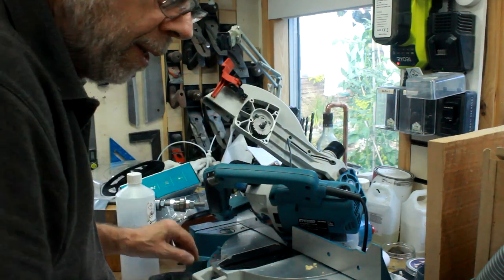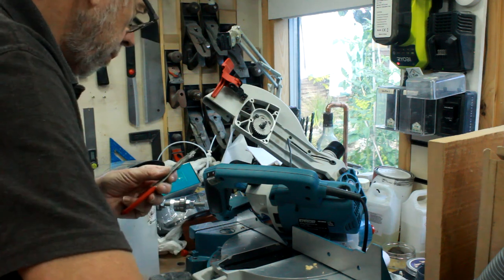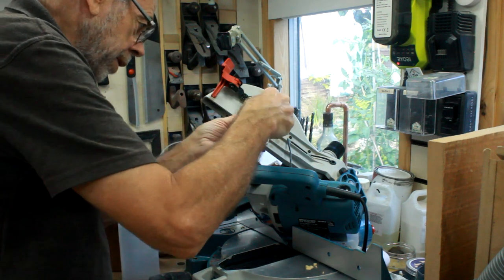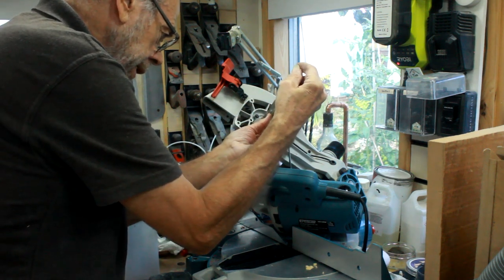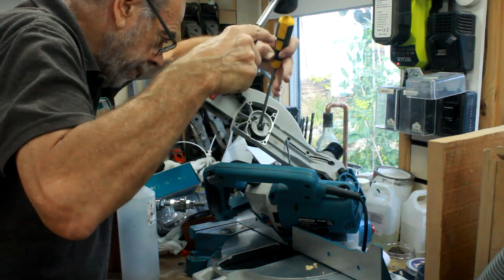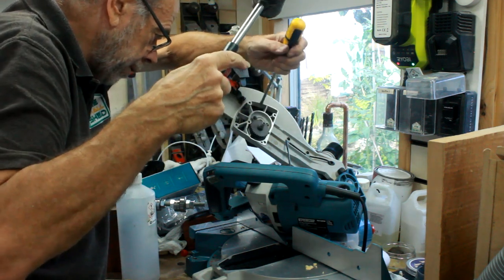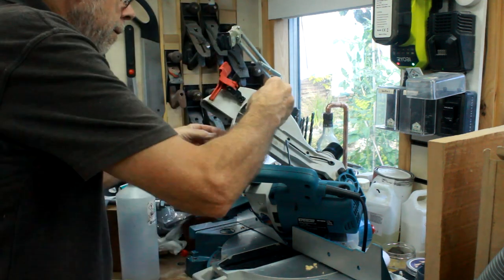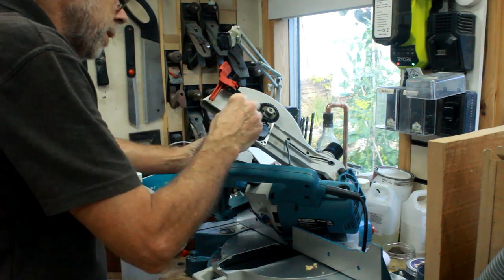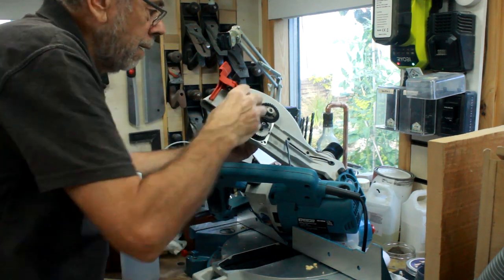That's got my groove back for the little circlip. All I need to do is pop that on and reassemble. The most important thing I mustn't forget to do is to pack it with grease again because we took all the grease out. That can now slot into place - so that has the cog on with the circlip. Put the other cog on, screw that in from the other side, and I'm just going to reassemble it now which is basically a reversal of what we did before. We'll come back when we've got it done.